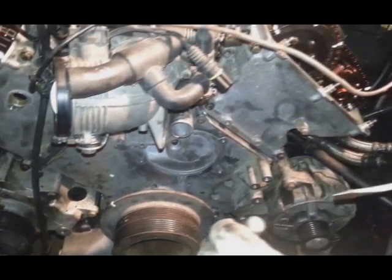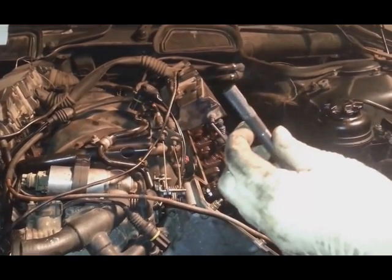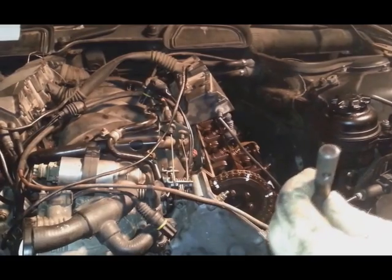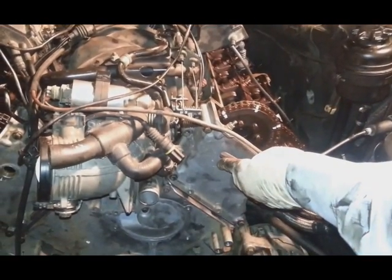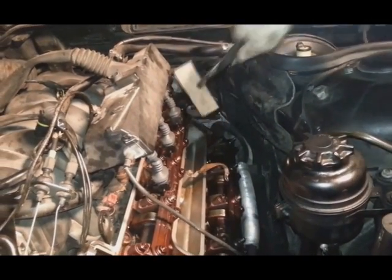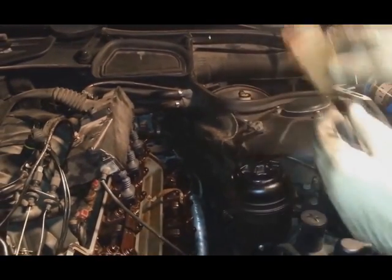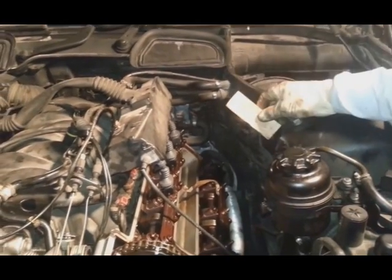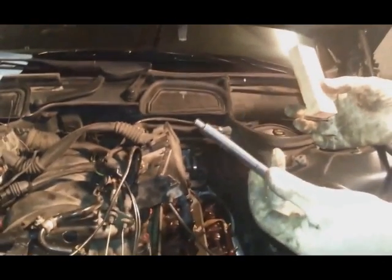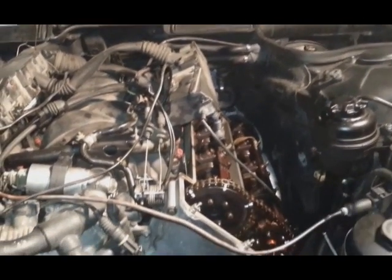So we install the crankshaft pulley. Then you can remove the special tool you locked the flywheel with. That's what it looks like. You need this for sure. And now we install the upper timing chain covers, both sides. Then I remove the tools. The one I locked the cam with is on the back. Here we go. See? Like I said, I cut wood 4 1/4 and it fits perfect on the back. That's all you need, the kind of tools to do work like timing chain on a BMW. And for sure you need a hammer too.